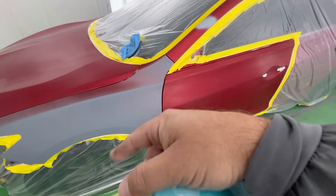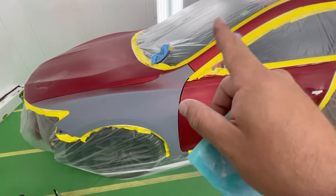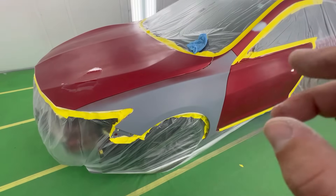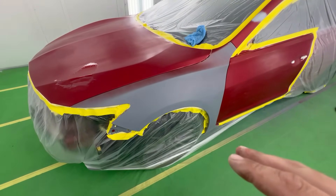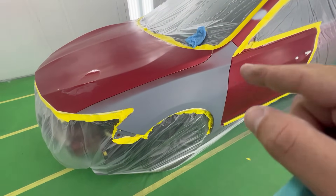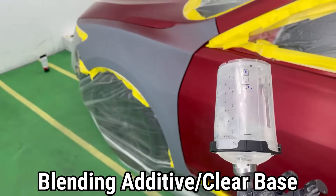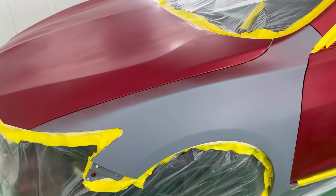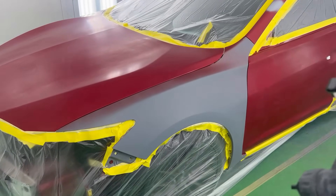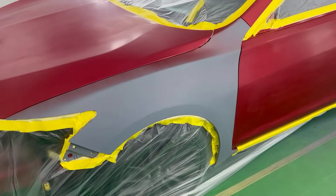This was going to be a little blend just to make sure my color match was right — doing this for free, I always want to make sure everything matches. Then I found a scratch on my blend area, so we took it a little further. The first material I'm going to put down is a clear base, and I'm going to use it as a visual aid — not as a wet bed. You can use clear base a few different ways. The reason I like using it as a visual aid is it goes on with a satin finish, kind of like the base coat, and I can see how good my blend is going to look.